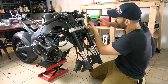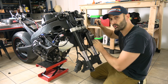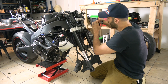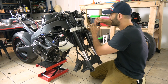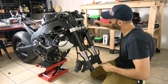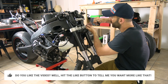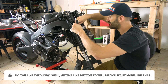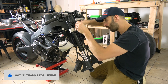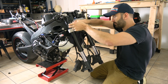I highly recommend you use a torque wrench and follow the torque spec in your service manual. I'll do it by feel for the video since it's not my first time and I have an idea of the torque needed on those pinch bolts. You always need to go back and forth a couple of times because as you tighten one bolt the other gets loose, so that's why you see me going from one to the other. The lower triple clamp looks good on those tubes.